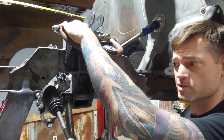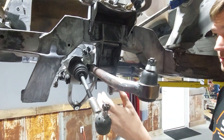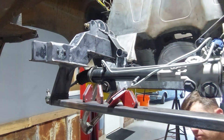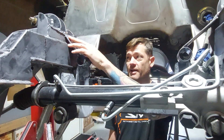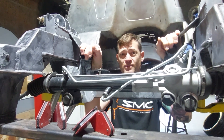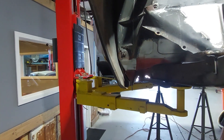Everything lined up real good — it's gonna be a sliding control arm with shims, so it'll be a little easier on alignments. Got everything set up yesterday afternoon to make a lower mount, so steering's going in there. Both engine mounts are also integrated into the upper spring, and everything flows together — it's all welded together so it's nice and stiff and strong. If he wants to hit the switch hard when the shockwaves are on, he can do it. Shawn's a form and function guy.